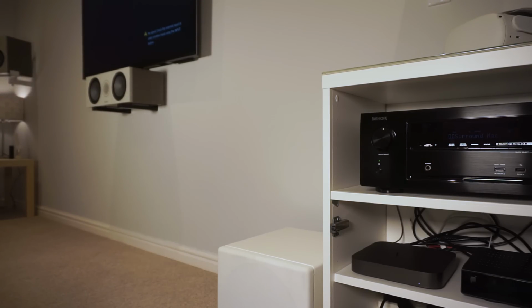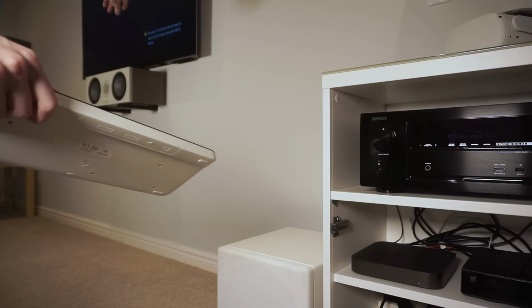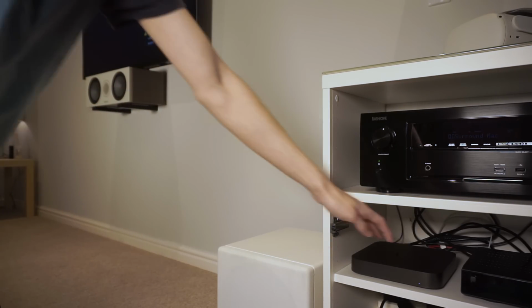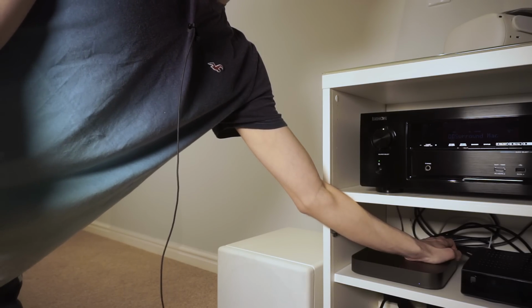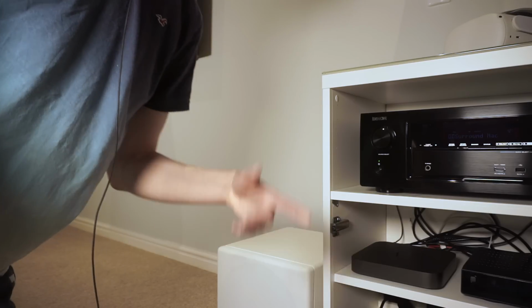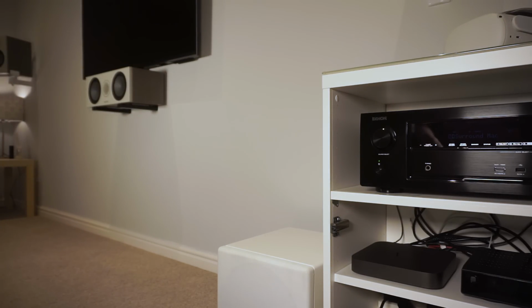And even if I were to move the mouse, click buttons on it, the TV will never switch off of that screen. It's maybe hard to make out on camera, but you can see the no signal thing in the bottom corner. So that's not working. And then the only way to fix it is to hard power down the Mac Mini using the button on the back. And then turn it on again once this is back sitting on the Denon screen without that no signal message. And this is obviously really annoying.